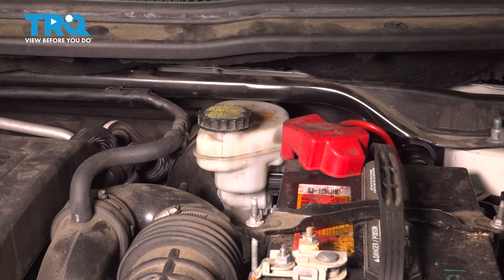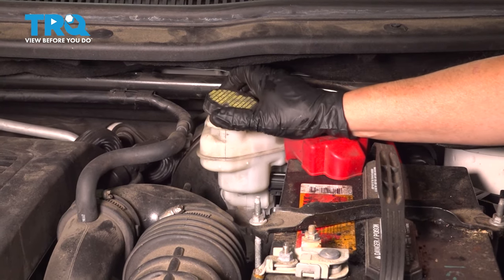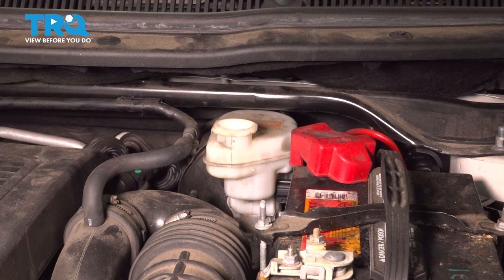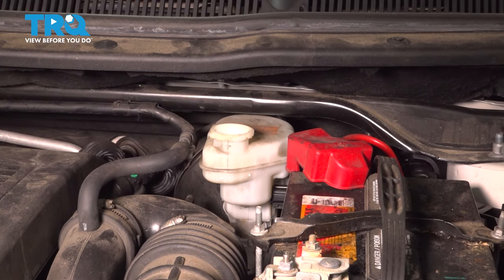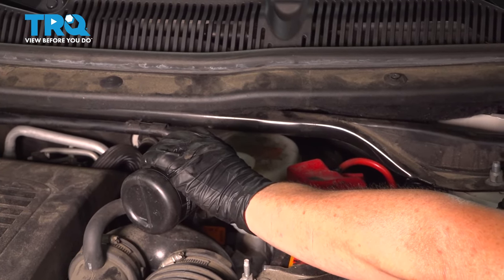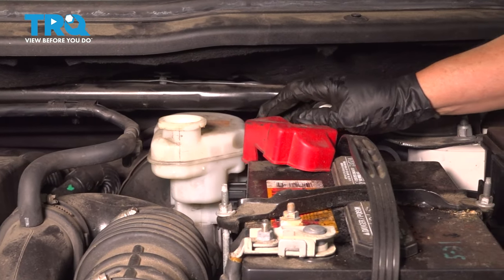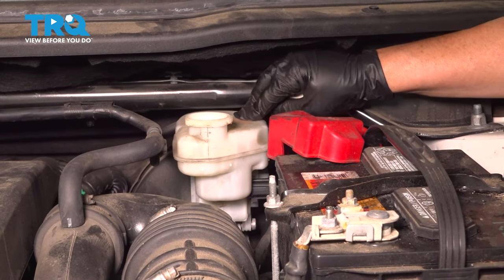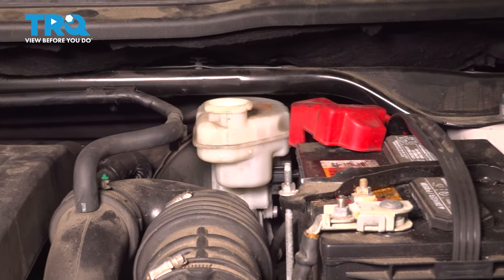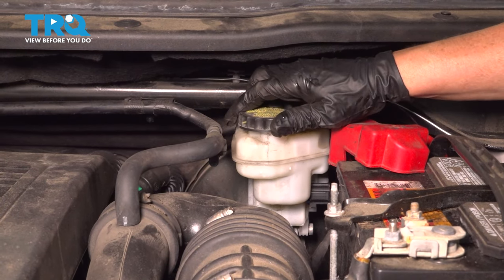Now that you're done with your brakes — great job. You've pumped up your brakes. Open the hood and go to the master cylinder, which is located in front of the driver's seat. Take that cover off and confirm what fluid it takes — this takes only DOT 4. We're just going to top off our master. You'll see right where the line is — don't go above it. The line is on the side and it'll say max and min. Sometimes shake it to confirm where the fluid is because it can be hard to see. Top it off just a bit, make sure no dust or grease falls in, the seal cover is good, then lock it.